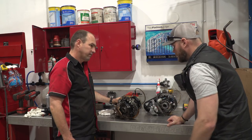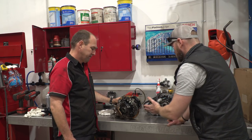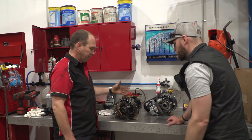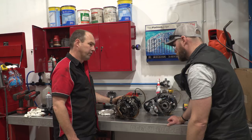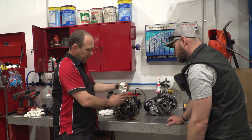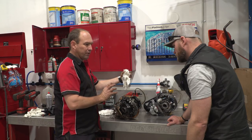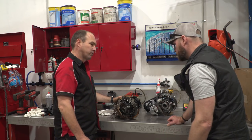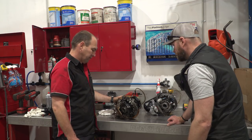When this initially happened, we were talking about maybe it's just a crumpled pinion. But you're better off replacing the whole lot. In this case we had to anyway, because the housing is bent — it's flexing, so you can't really reuse it. You could adjust it, but the problem is because it's twisted, the bearings are not going to sit parallel. You're going to have a knock-on effect of other problems. It just won't be reliable.